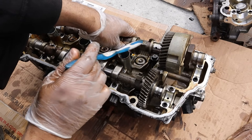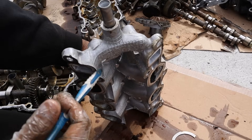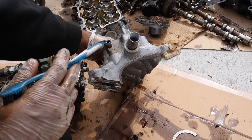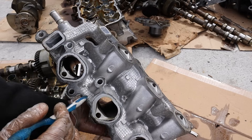The exhaust side is the one directly driven by the timing belt, but the variable valve timing is only on the intake side for these engines. Looking at the variable valve timing system, there's an oil gallery that brings extra oil up to the oil control solenoid, which is computer-controlled. This then supplies or removes oil from the system which feeds the variable valve timing gear through the galleys and ports. Now taking a look at the intake manifold, there is a coolant crossover that goes from one head over to the other, with two T's off of that which cool the throttle body — though there isn't any coolant that actually circulates around the intake manifold itself.